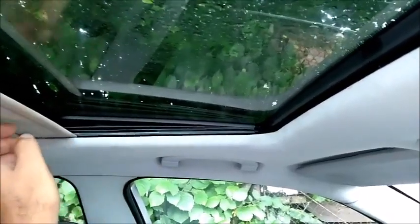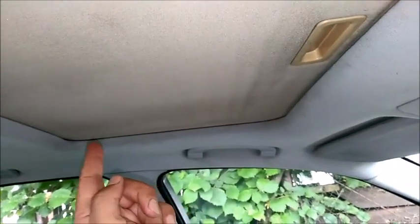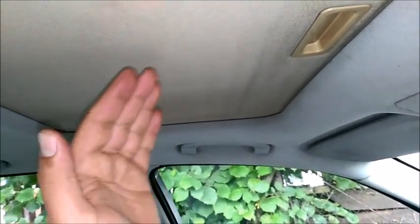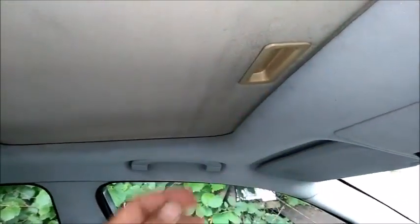Second tip, always when you have it closed, like I have it closed now, and you want to open, most of us will have the sunroof shade open. I recommend before you open it fully that you close the sunshade, let it move with the mechanism itself. So many problems with the guys, from what I read and what I hear, it will happen that the wheels, the tracks of the sunshade itself will get broken because it's exaggerated when opening. If there's any catch from the mechanism to the sunshade, it will hold it more back. So always close it.